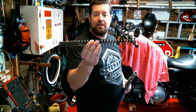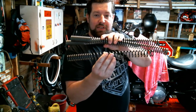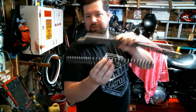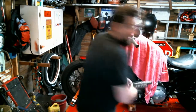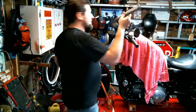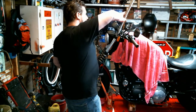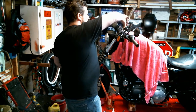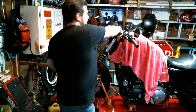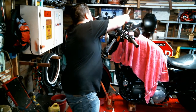Got the old spring here — you can see the approximate winding of it. On the other side we've got the new springs. You can tell it's a much heavier gauge with varying rings and diameters. Old springs are out; new springs are right here. Going to slide them right in just like we did before — we're actually going to put the progressive end up on top, because I believe that moves a little bit more and there's less chance of it foaming that way. Ever so slightly drop it down in there, same with the other side.